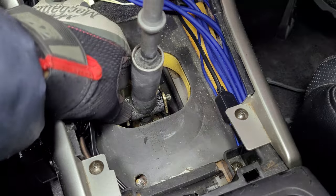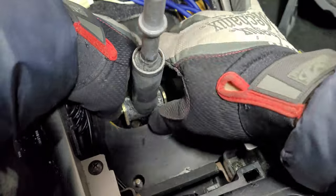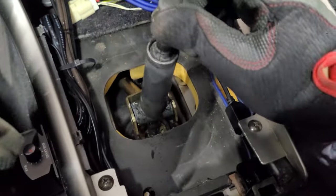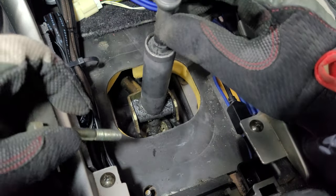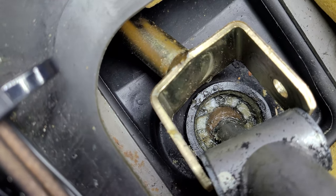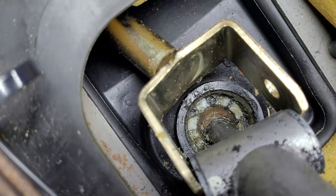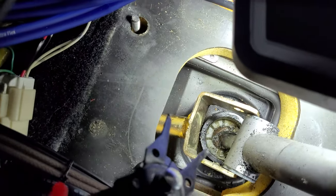Okay, so I got the nut off, let's take the bolt out. That was a bit tricky to get out — I had to just wobble this around a little bit — but it came free. Linkage is free. Now we can move in there with the pliers and see if we can take that ring out. I wasn't able to get my pliers in there — the heads get in but then they slip out. So I'm going to run out and grab that snap ring pliers and come back at this. Alright, I got the snap ring pliers, and it was super easy to take that snap ring off.